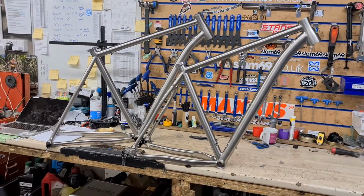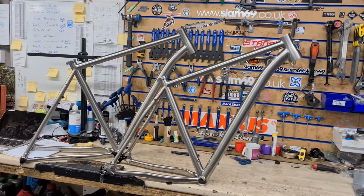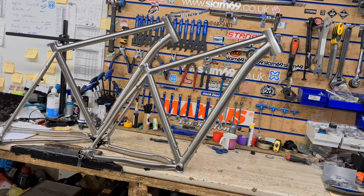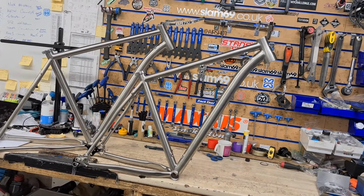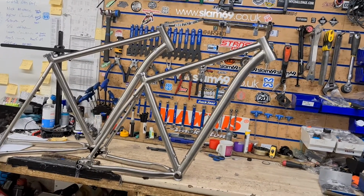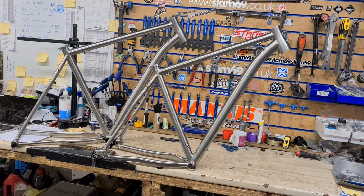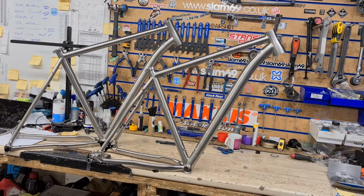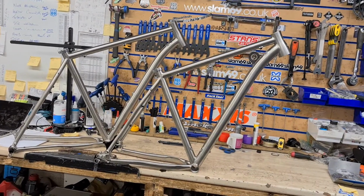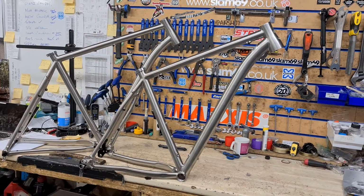They are selling well. If you want one, you can come and try our large demo bike. It seems to give most people the idea of how it rides. I know it's a large, but it fits a lot of people, just to give you the feeling of what it rides like. The head angle on these is with the standard axle. The fork we designed this around has an axle to crown of 500, which means you could run a suspension fork up to 120 mil of travel.